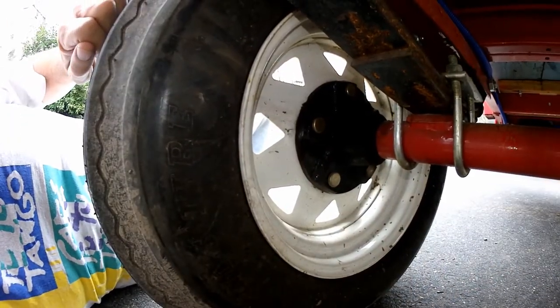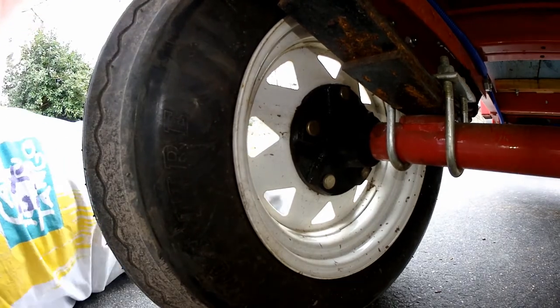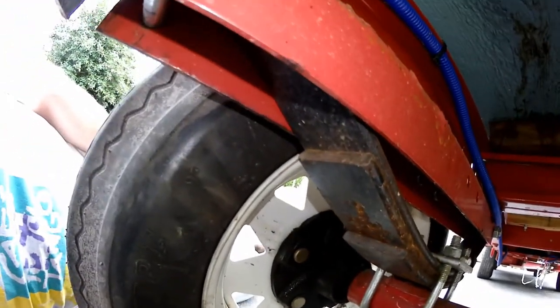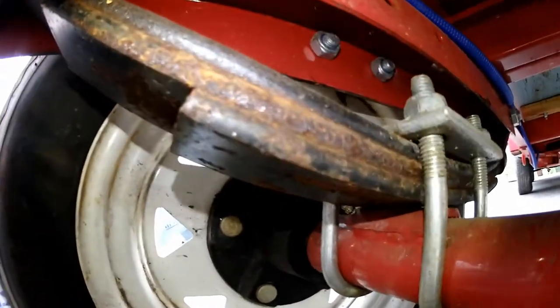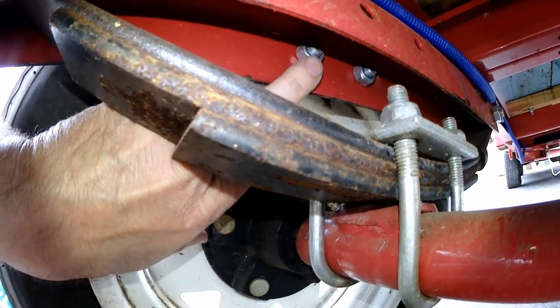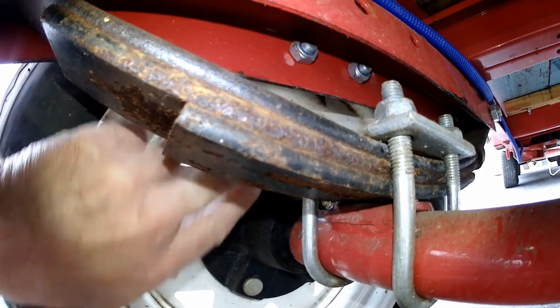No apparent serious rubbing there that I can see. You can see this leaf spring is still about half loaded. There's still a lot of play in there. There are the inside bolts to take that fender mounting bracket off — I couldn't really get to them without a swivel adapter for my ratchet, which I didn't have in the truck. I'm just thankful I had any tools.